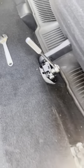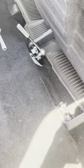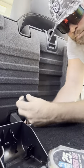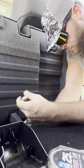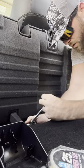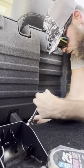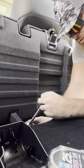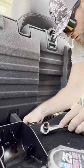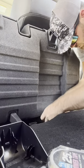It's two bolts per seat and they're 14 millimeter. I'm about six foot two, and with just the seat folded forward it doesn't give you quite enough room — I measured it at about six foot even. When you take the seat out, it gives you about four extra inches of headroom for taller people. That's why I'm actually removing the seats rather than just folding them up.